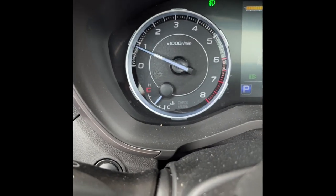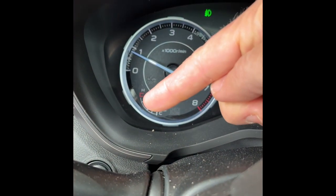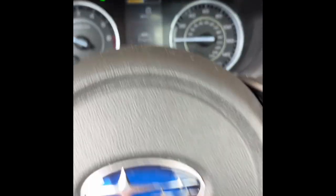I'm gonna back it up and just leave it running. The reason why is you always want to change a car when the oil is warm or hot — if you don't let it get warm or hot, the old dirty oil will be stuck all up inside the engine. The way that you can tell when the car is hot is by using the temperature gauge — it'll come up off the cold and go into the middle, and that's how you tell when the car is nice and warm.